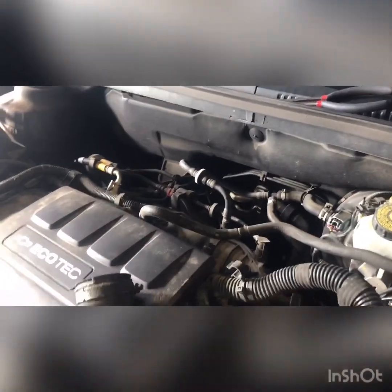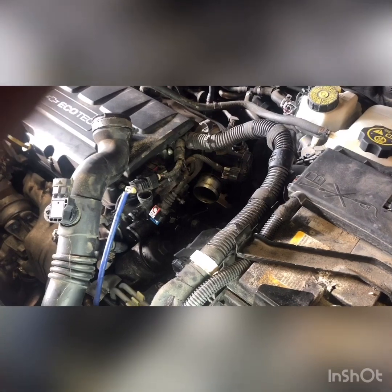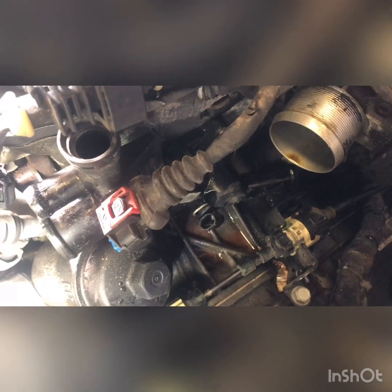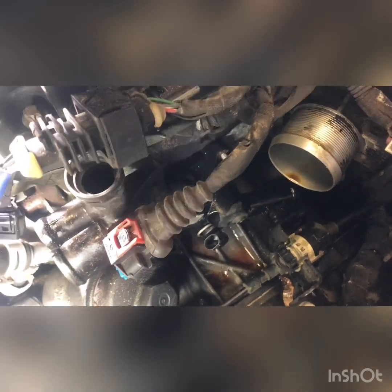You can test whether the sensor is bad or if you're actually overheating. By unplugging that sensor, it dropped down to negative 40 degrees, so I know the sensor is reading wrong — because it didn't seem like the engine was hot anyway. You can kind of feel the radiator hoses carefully.